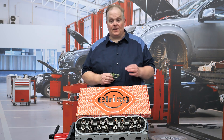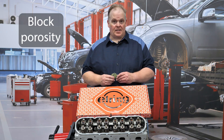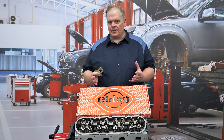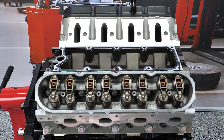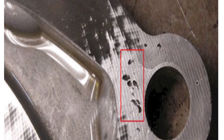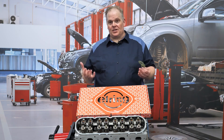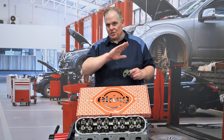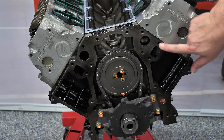The one thing that's even been in TSBs from General Motors is block porosity. This is not a structural issue — it's more of an appearance on some of the mating surfaces for the gasket. Essentially it's a void that happens while the parts have been cast. That part can have a tiny hole, and when it's machined down, it can get larger and larger, or even smaller, depending on how deep you go or where it's located.